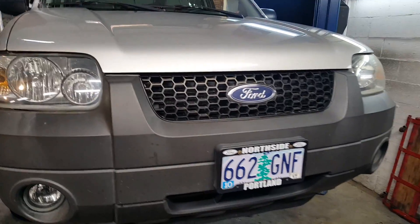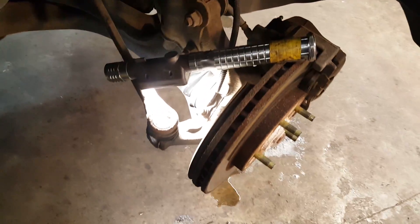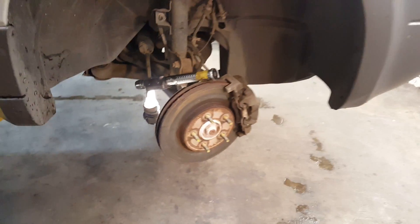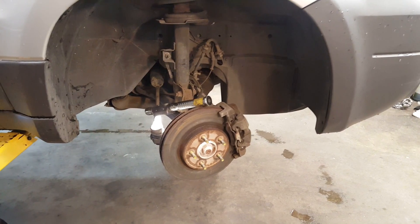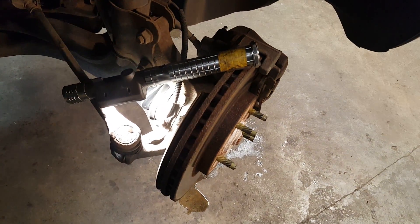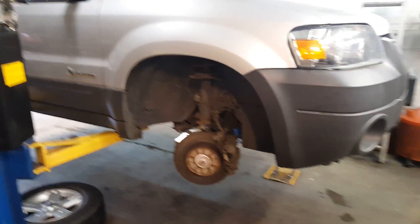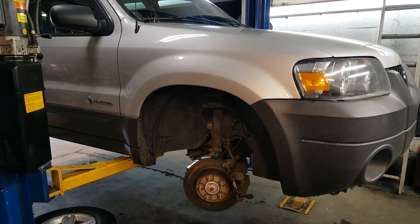It can't read the wheel speed, so it triggers the lights in the front. These are really good rigs — you see them all over the place. This is the first time I've encountered a tone ring breaking. Maybe you could JB weld it, I don't know, but the best fix is probably to replace the axle so you get a brand new tone ring. Tone rings are hard to find by themselves, and you have to take the thing apart to replace it anyway. Let's see if we can weld it up.